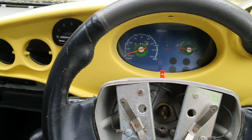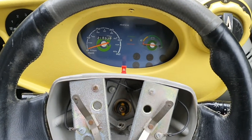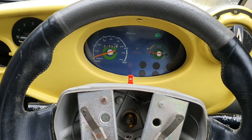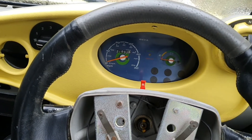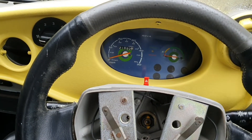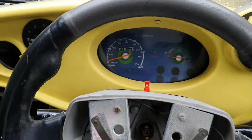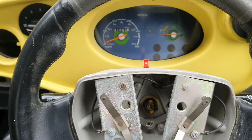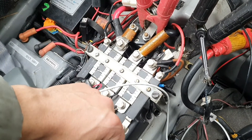After having a look around I cannot seem to get it to start. Judging by what's actually working: the lights are working, the hazards are working, but the indicators do not work and the blower does not work. My guess is it is definitely something to do with that ignition - that's why the rest isn't starting. I wonder if it needs a 12-volt feed in order to switch it on for reading on the laptop.